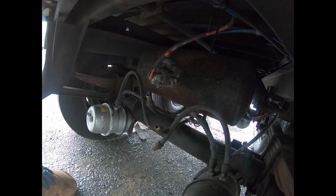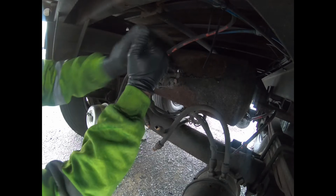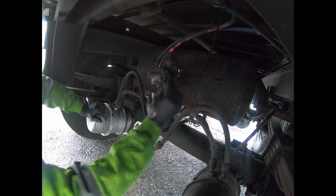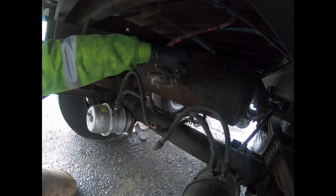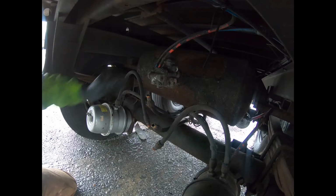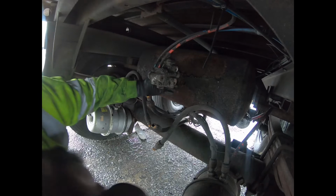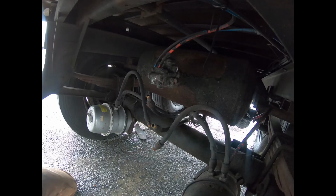Gets number two. So we gotta reach back here and get number three, which is an 11/16. Another 2 3/4. Thread it into our side. You get a little adjustable for this plug. Get the pipe plug out of side here. And then all that'll be left is the main fitting on the tank. Twist her out, and then we're good to go. Let me go grab a proper size wrench here, and I'll be right back.